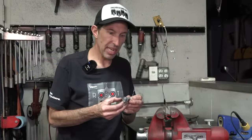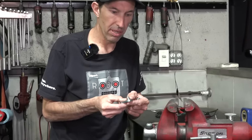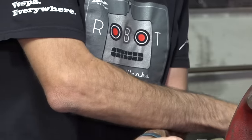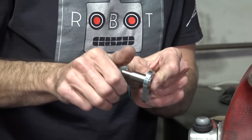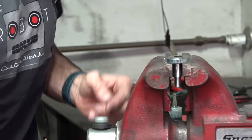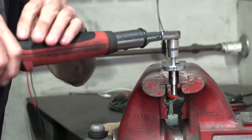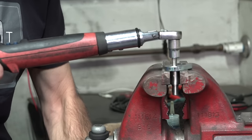Take the left hand bracket — there's a stud and a flat-headed screw. Put a small amount of blue loctite on the threads, then thread the stud on. Using a six millimeter allen, carefully pinch it down in a vise — it may put a small mark on it, but that won't hurt anything — and tighten it to about 15 to 16 foot-pounds. That's all set up and ready for installation.